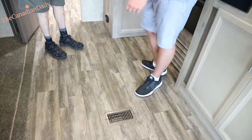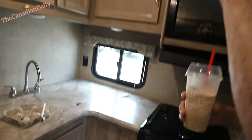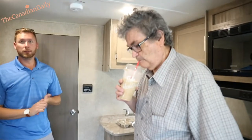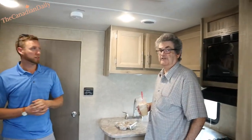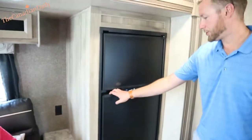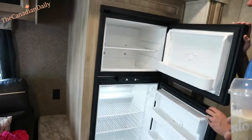The AC should kick in shortly. We've got our vent — pin back, we can close this area. There's only one roof vent in this unit and it's this one. I actually recommend keeping them open a little bit in the winter for airflow — the more airflow you can get in here the better. People that tarp them down — I don't recommend that — they sweat and can get moldy and mildew.